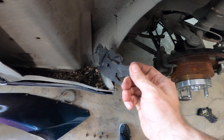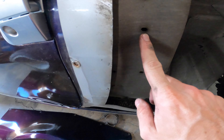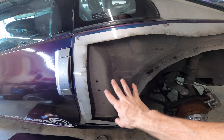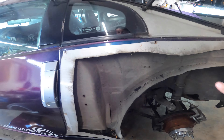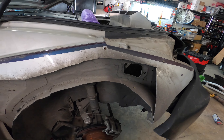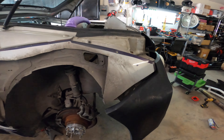I've also got a lot of junk in the side area where the overfenders go, and you can see there are holes everywhere. I'm going to end up sealing all of this up to help prevent smoke and dust ingress. The previous builder did a decent job covering some of them but not all, and it really needs to be completely sealed. I'm going to foam and seal it all up so we don't have to worry about that problem anymore.